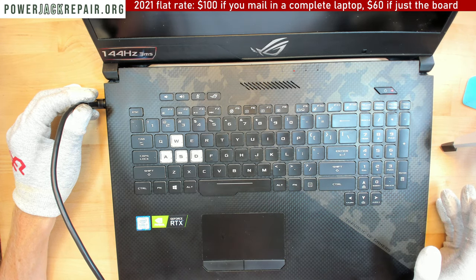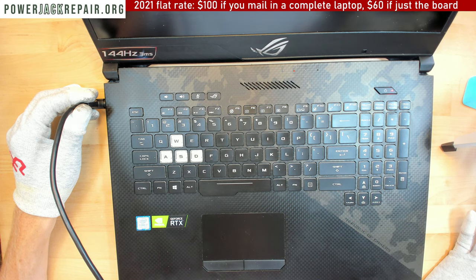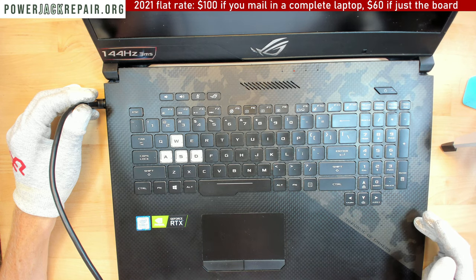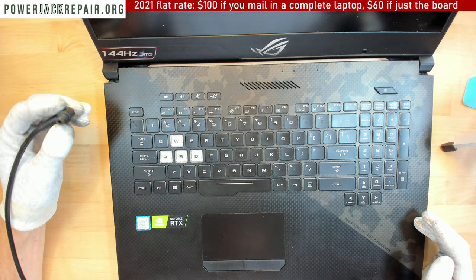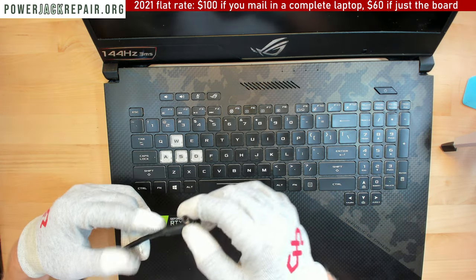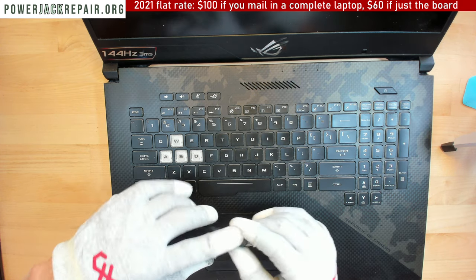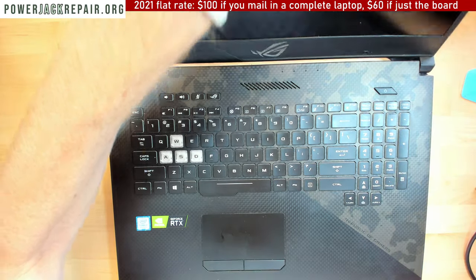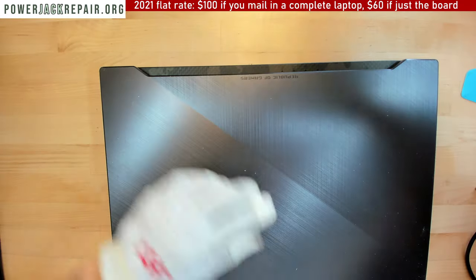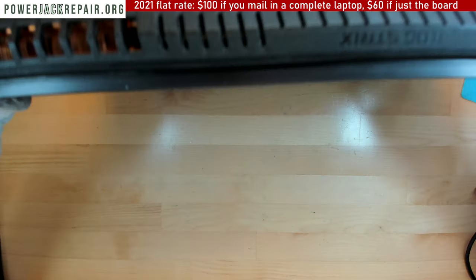The connection still won't be solid unless you buy a new power supply, which I don't sell, but you still need to get it off of eBay or some other source. This one could be anything because it's just a plus and a minus. There is no data signal coming through in here. The problem again is oxidation on the inside. I will use some contact cleaner to clean up the oxidation, but that will be a bit temporary.